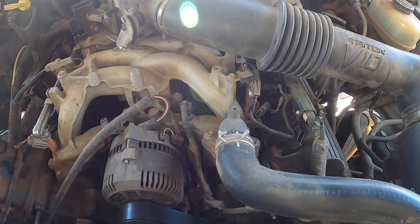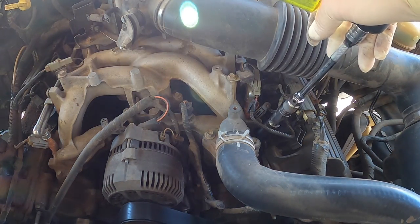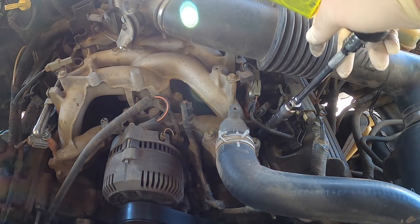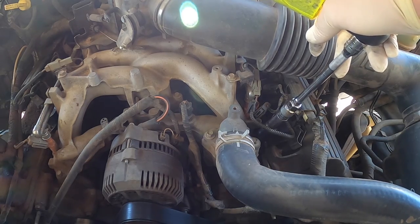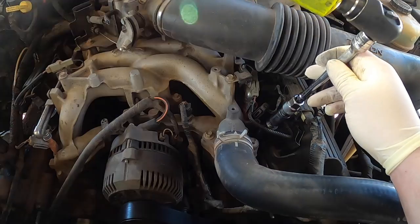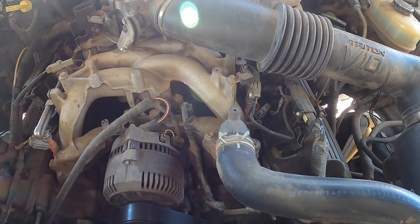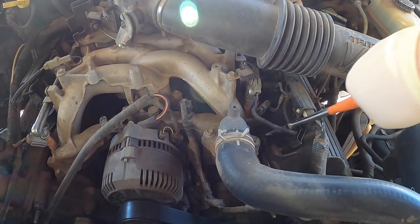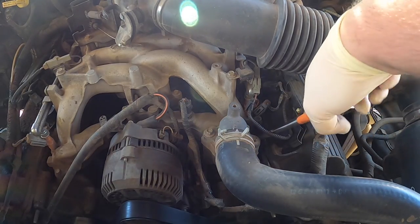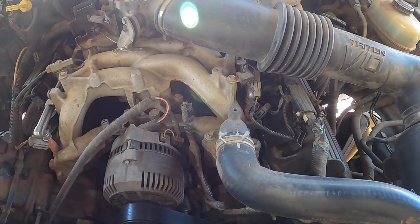Pack this with grease again — pack the flutes with it. We'll go ahead and run that down there again. Like I said, the valves are closed and the piston is down, so we're not going to hit nothing. We're just going to cut the cylinder head. There we go. The bit on the thing is worn out — that holds the tap in. About half of it. You can tell when it hits the bottom because there's metal right there, so we know it ran through the whole path.